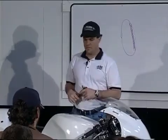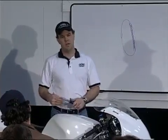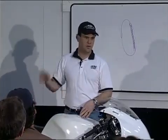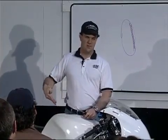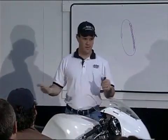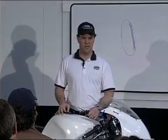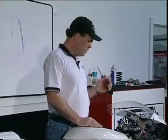Now, what's going to be our symptoms of not enough rebound damping? In a shock, it's almost impossible for somebody to show me where they don't have enough rebound damping. The only instances that I've ever heard, and I've only seen two or three people do this, was on a shock that was extremely, extremely loose. This is a top level pro guy, like Michael Barnes, formerly USA champion. He's able to get the back tire to dribble a little bit in the middle of a turn, but it's almost impossible. You'll never come across somebody complaining because they have too much rebound in the shock. Or not enough, I'm sorry. In the fork, not enough rebound.